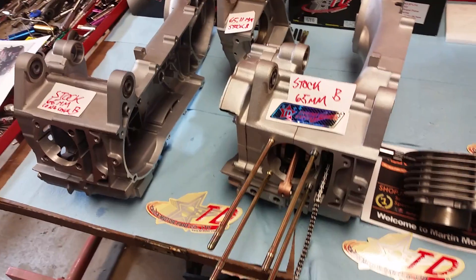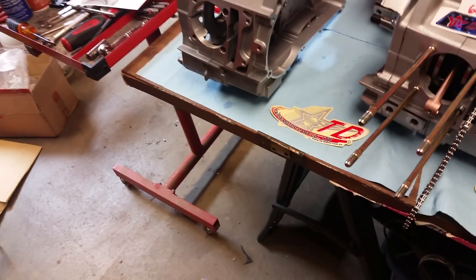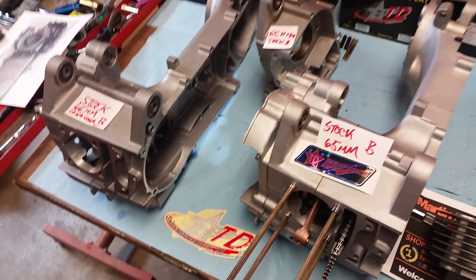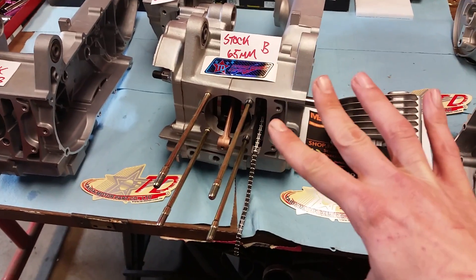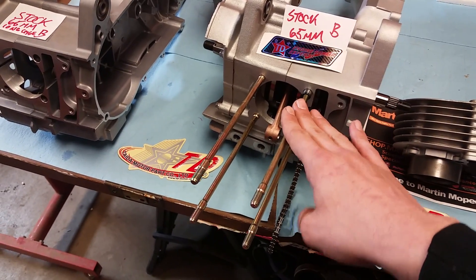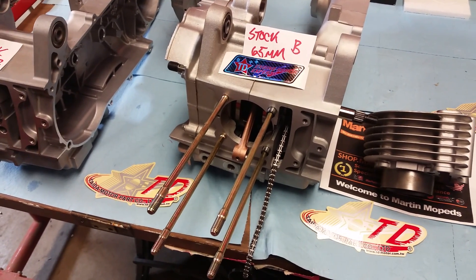So that covers what you can bore this stuff out to. The 180cc power kit, same thing with the GY6 200 — maximum 63 millimeter to fit a 65 to 66.5 millimeter outer diameter skirt. Over here with Tata long case you can go 70 millimeters. Tata's short case is its own story — completely different. Maximum you can put in there is 66 millimeters. Tata has one cylinder kit for that and it's a custom one they don't normally even sell — it only comes with the engine kits.